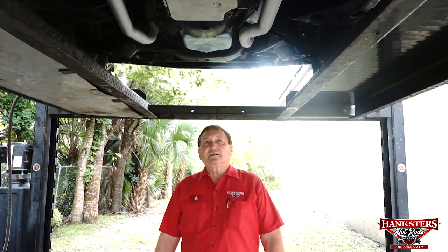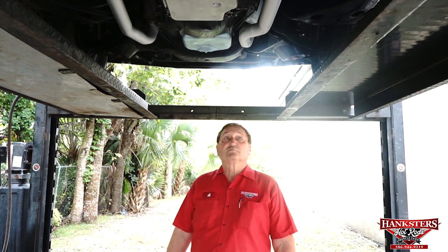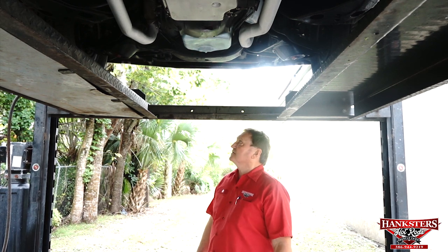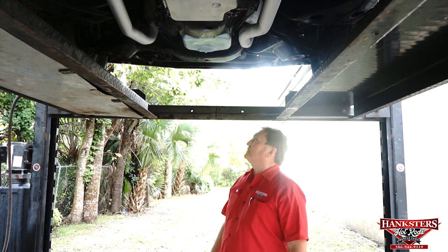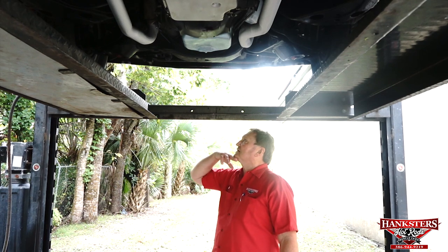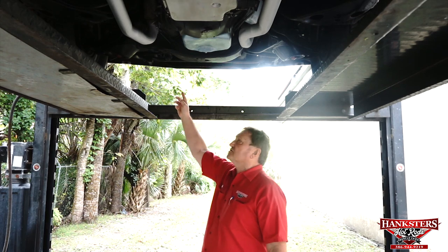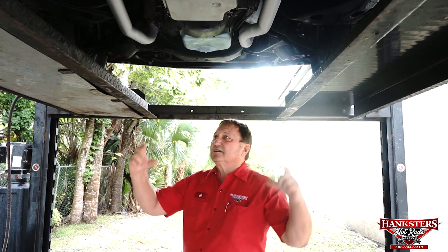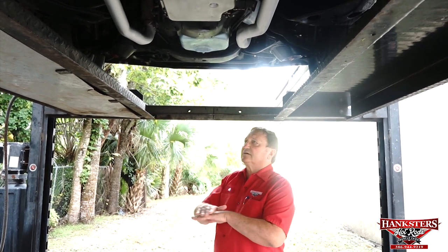Okay, we're underneath our 1967 Pontiac GTO. Really a great original, nice looking car. Nothing's really been disrupted underneath this undercarriage. We'll go over it with you and see what we can find. Original equipment style sway bar that came from the factory on these cars. Nice big box frame section starting at the very nose and going back to the two lateral sections of frame that are C-channel frames, but it's full box to that point, right about where your feet are in the floor of the car in the front.